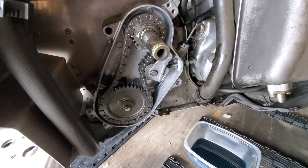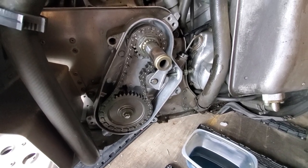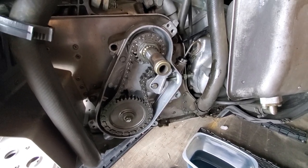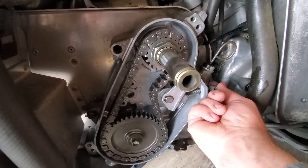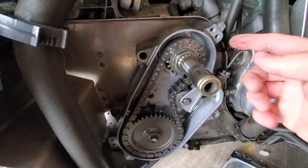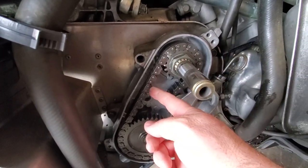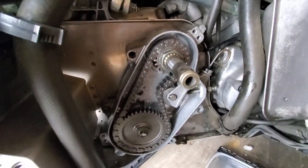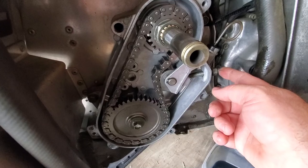So there's both the gears back in, and we're gonna go ahead and tighten up the bolt on the bottom, the nut on the top, and then we'll set the chain tension. So I got everything tightened back up again. Went ahead and tightened the chain tension. It's kind of handy that when you tighten this nut at the top, it pulls the tension out of all the drivetrain in the machine. And then you can adjust the tensioner over here.